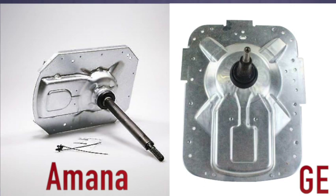Looking at the gearboxes, again GE has a better-built component. GE gearboxes use grease to lubricate the inside moving parts, while Amana uses gear oil. Both machines have gear cases that are tack-welded so the bearings are not serviceable — if the bearings or seals go out, you have to change the entire gearbox, which is a very expensive piece. Both machines are known to have bearing failures, but Amana bearings and seals fail much more often than GE. I suspect it's because when the GE gearbox's bottom seal fails, the grease maintains lubrication, whereas when Amana seals fail, the oil runs out, the gears dry out, and wear out faster. The GE wins the gearbox category.